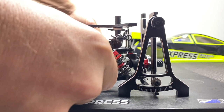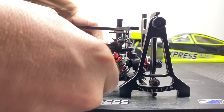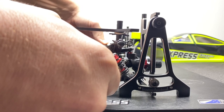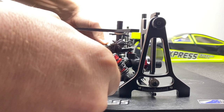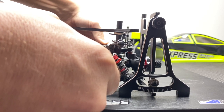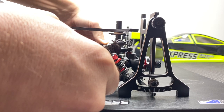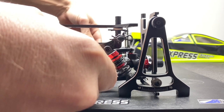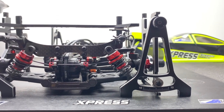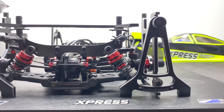So if I twist the car like that — chassis is almost scraping and the inside is lifting up a little bit — we're mimicking what the car would do on the track. We're now at almost 1 degree positive camber. Now that's bad. That's going to roll on the outside of the tyre, cause all sorts of problems, not bite, cause corner speed issues, tire wear issues, and the back's going to come flying around — hard to drive. But people think it's something else.